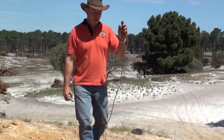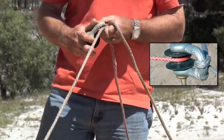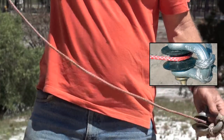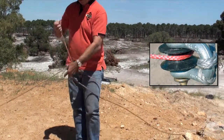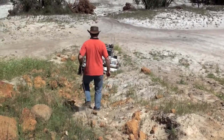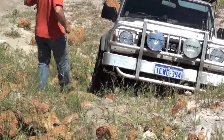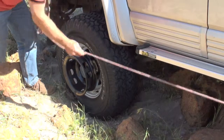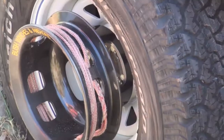I've come up to the bridle and I'm now going to show you how we put the pulley onto the bridle — no knots, very easily done, like so. Take the winch line through that pulley and across to the second pulley already in line, and now back to the other side of the vehicle.